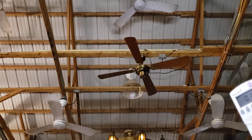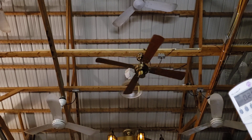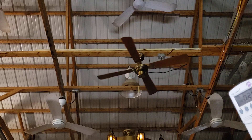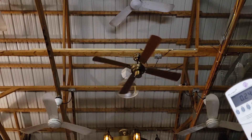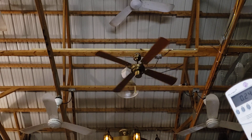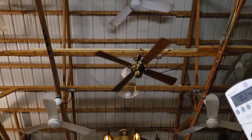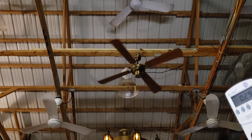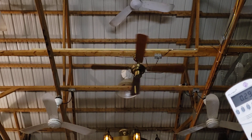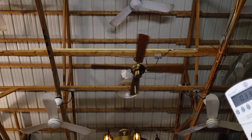Here's four, here's five. What finish is that? Gold paint essentially - it was originally brown from the factory it looks like. It's interesting that they didn't just buy a polished brass original and stick it on there - they instead painted it. I think they wanted it to match because everything else was in that color. It's a two-speed original, but it was hardwired for just high. The other ones I've seen have the original two-speed pull chain and a light dimmer, but that one was capped off - this one clearly was sold possibly custom ordered, and if they were going to use a wall control, you don't need the low speed or the light dimmer.